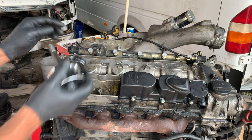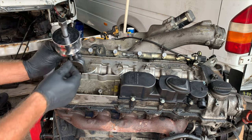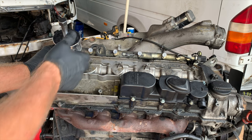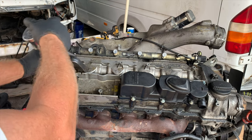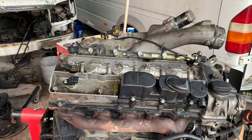With this hooked into your injector, put a heavy weight on it, screw that in, say a little prayer, go ahead and cut off your thumbs because it hurts less than getting them pinched in right there. And smack, smack, try to beat that thing out. I have never found this successful. Others have.